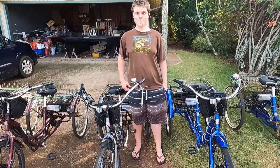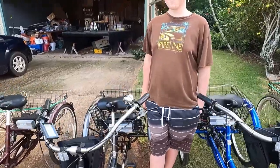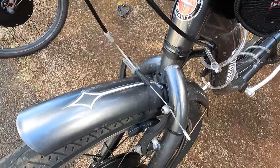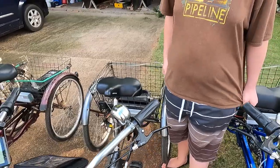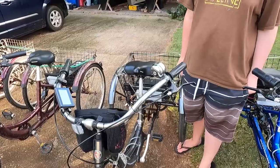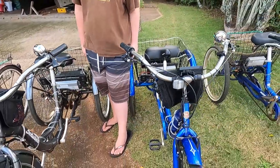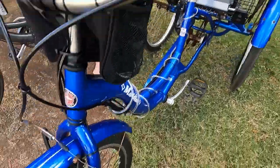Installation tip: this shows how important it is to switch the brakes from left to right. The default way these Schwinn bikes are installed, the brakes are on the left side — depressing the left brake activates the front brake, where most of your braking power comes from. The problem is if you're trying to make a turn in the road you need your left hand for road signals. That's hard to do when you're also trying to come to a stop at the same time. So even though it makes the cables a little cattywampus, we've learned to swap the controls.